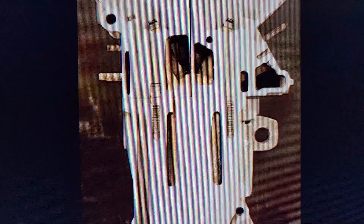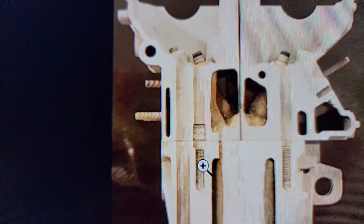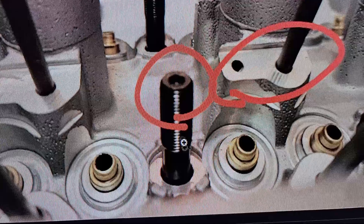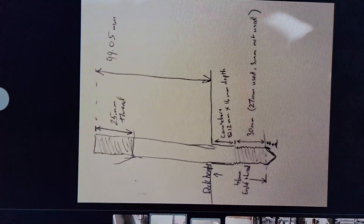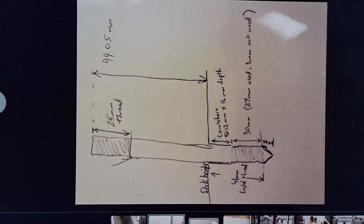Here's a good example - this is a block cut in half as an example piece. You can see the threads submerged down into the block. If my threads are where this mark is right there, I need to go deeper to where this one bottoms out. Go down an inch and now the threads are down here instead. The top portion needs a washer and then needs to clamp down at the bottom. I need to bury this another inch or three quarters of an inch. Here's a real-life application of where it actually needs to sit. I should have done this research prior, but we can still salvage this block and it will be just as good as before.